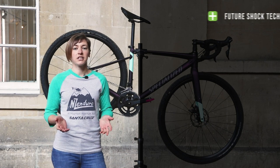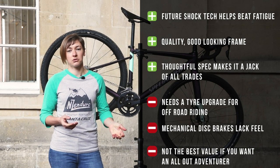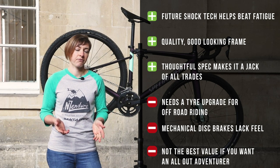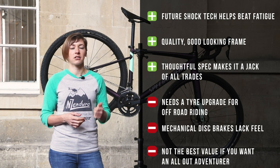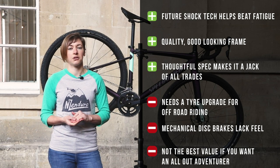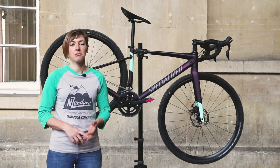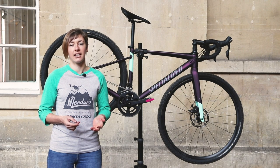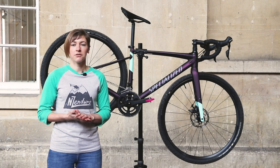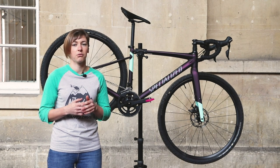If it were my money though, and adventure was high on my list of priorities, then the Diverge in this spec isn't the ideal partner. The 2x drivetrain will get clogged with mud and the brakes are lacking feel, and it's hard to balance those shortcomings against the benefits of the Future Shock. I'd be tempted to splash £500 more and get the hydraulic disc brakes and carbon frame of the women's Diverge at two grand, then in time upgrade to a 1x drivetrain to replace the 10-speed Tiagra of that bike. This Diverge E5 Comp makes sense if you're going to spend a majority of time on the road, commuting on rougher roads and dirty tarmac — then it'd be a great teammate. The 2x drivetrain would keep you spinning along, the brakes would do their job adequately, plus there's the added comfort of the Future Shock when you do take it off the beaten track.